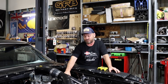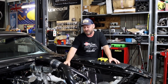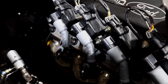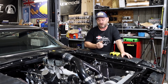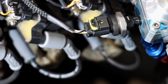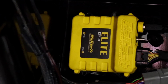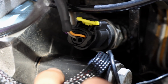If you were doing this from scratch, you'd probably get some IGN-1A coils from Haltech — basically a similar sort of thing but a lot more powerful. In this case, I think the LS3 coils would be perfectly fine. But the rest of it is all about data logging. We now have sensors for fuel pressure, oil pressure, a throttle position sensor, an internal MAP sensor, and also coolant temperature and coolant pressure.